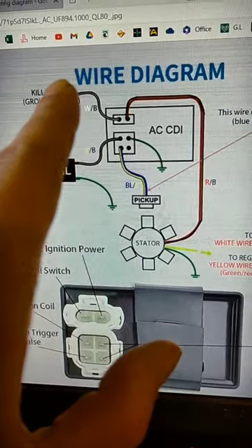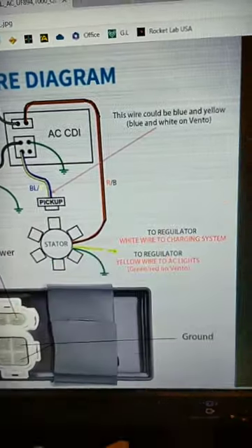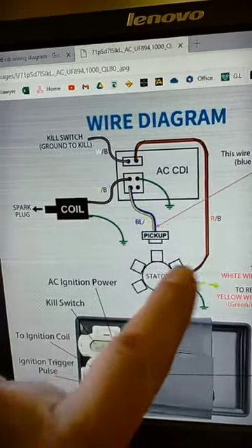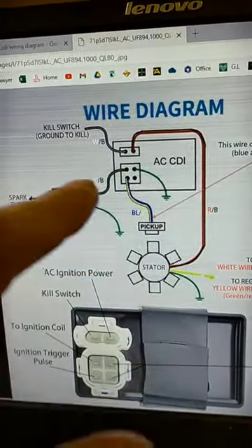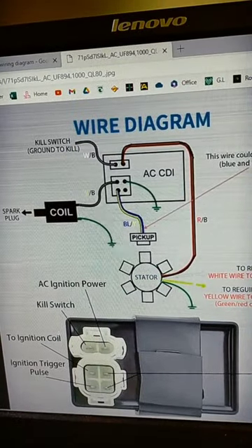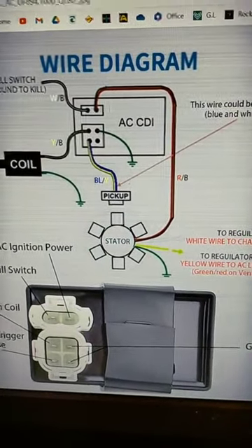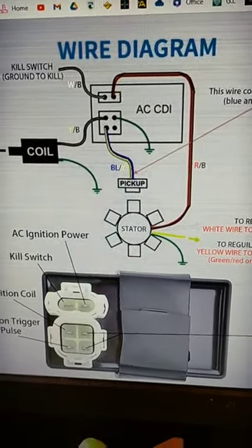The way you can check what's connected to what is the same method I'm going to use to check my regulator with my bell tester and work out which way the diodes are connected. If you connect to the wire that goes to your kill switch, one will be going back to your stator — that's obviously your kill switch circuit and your mains from the stator. Then you can work out what is connected to the coil, whether it be the pickup and so on. That way you work out what is connected to what, rather than relying on wire colours, because they are often all different.